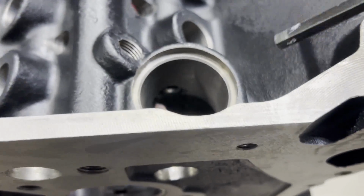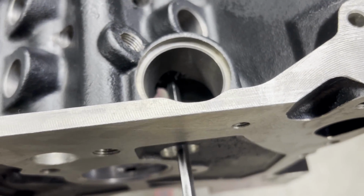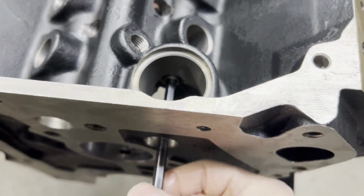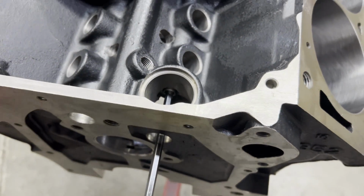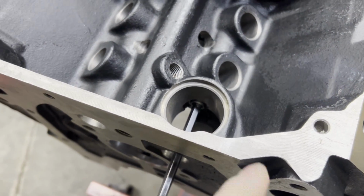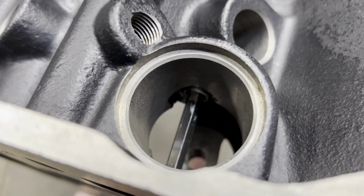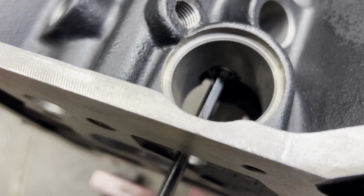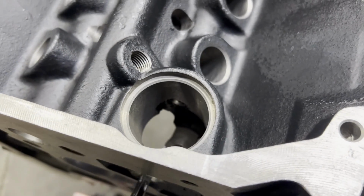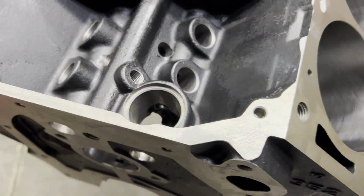Okay, so here's just something on camera to show. This plug, you always try these out on aftermarket blocks, and when you're using a stock block, factory block, and you tap that, make sure that you run a plug in it and make sure it's underneath that surface of the distributor. So this one as well, underneath. When you tighten it up, you don't want the distributor hanging on that guy. So we're in good shape here. Let me throw my tools on the floor.